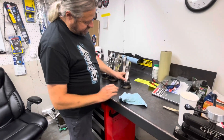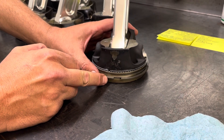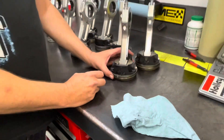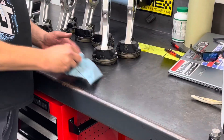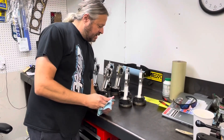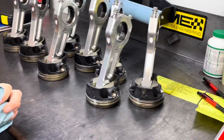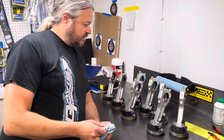Another one — ring gap. You check ring gap out of the bore. See how that looks? It's pretty spread, looks pretty much like when you put it in day one. Now look at this one — it's half. If you were to carefully slide this ring off the piston and put it in the bore, I can about guarantee you there are places where you'd see light around it because it's no longer round. The heat has gotten to it and it's distorted. Somewhere in the tuning process this one got a little pissed off. I don't think it's currently that pissed off, but at some point it did just a little bit and they got that ring a little hot. There are several places you can look on any of these things to find problems. You're a fool if you don't pay attention to this because it'll save you a bunch of aggravation. Overall this thing looks pretty happy — there are a few things we're going to tune up, but that's a quick place to look.